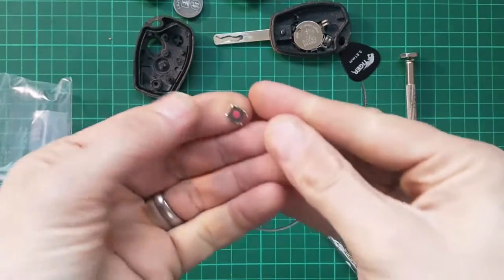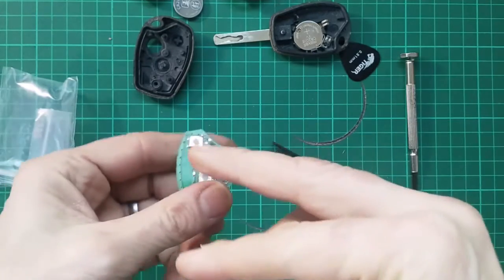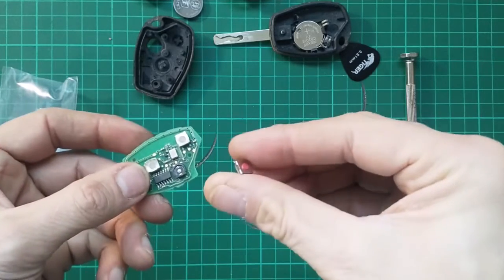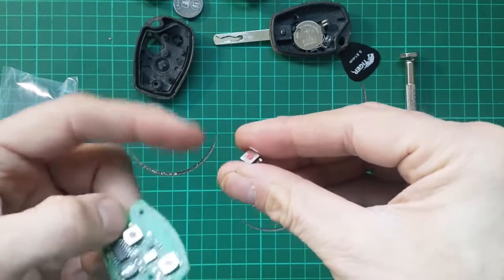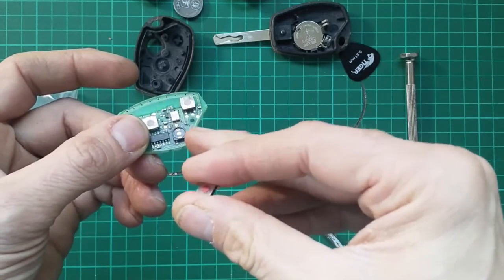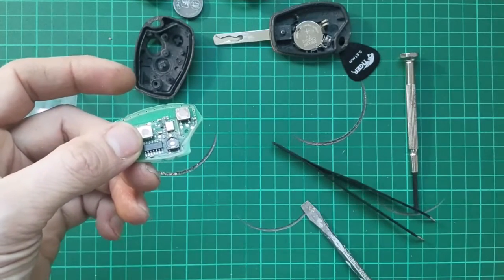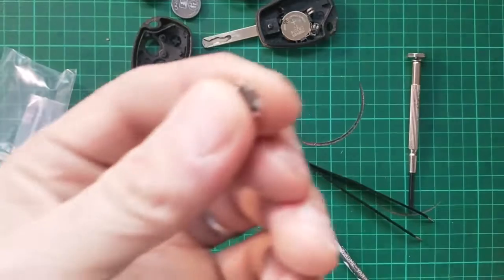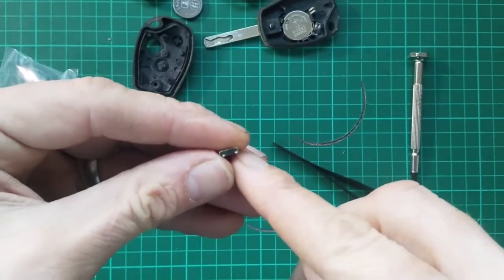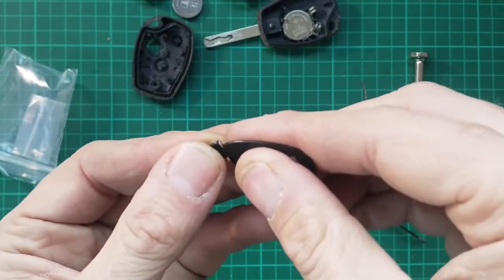I'm also blessed with the benefit of 3 of these replacement switches and 2 still working ones on the original board. So what I'm going to do is first give it a go to extract the little metal bit off the switch elements from this switch and just clip that straight on, which will be easier than soldering. If that fails, then I'll think about the soldering route. Now, this is really just a very thin little sprung steel clip on top of the plastic housing, so I may be able to just tease it off with my little pick here.